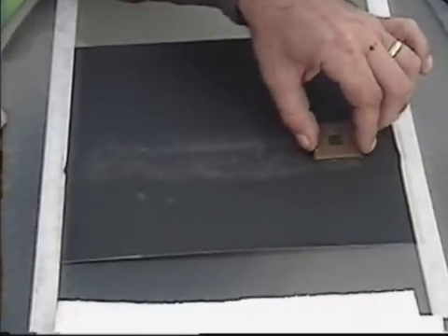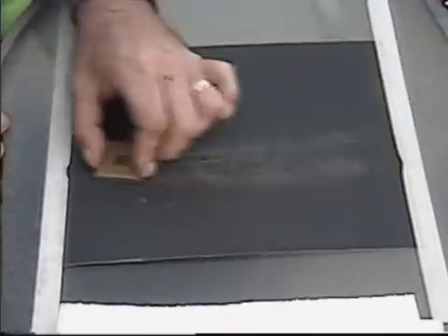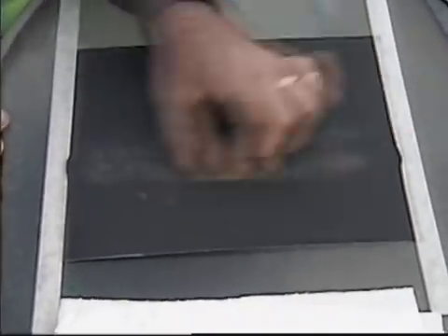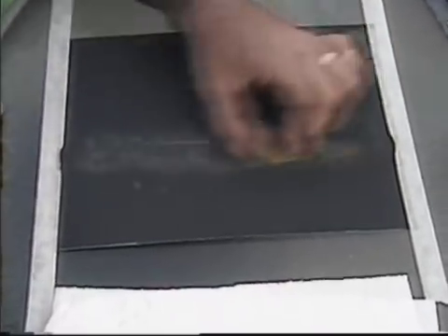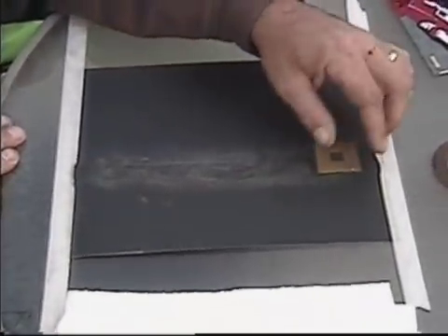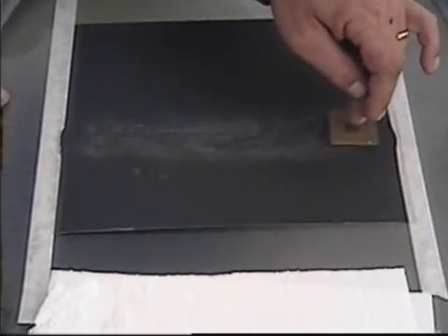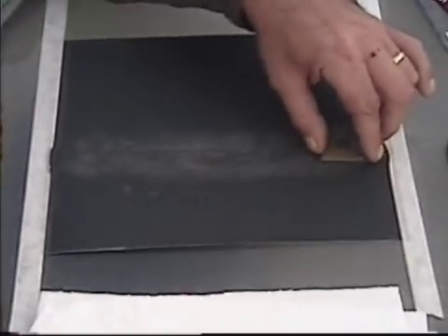Turn it a quarter turn. Another thing I want to mention: when you're doing this, don't push down on the CPU. Let the weight of the CPU do the work — just hold it in the corners around the edges. And watch out if you have pins, like his has pins. Mine's totally flat, but just don't push down. That way you don't bend any pins up.